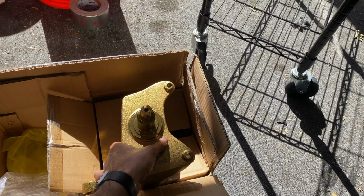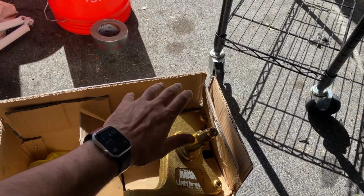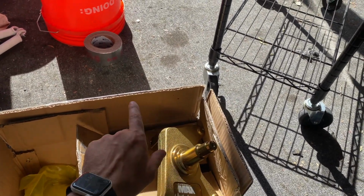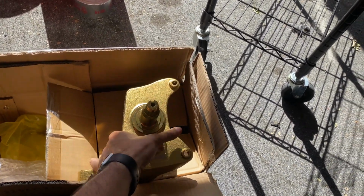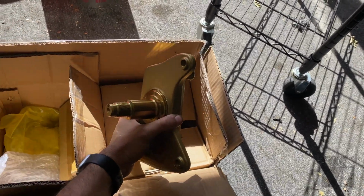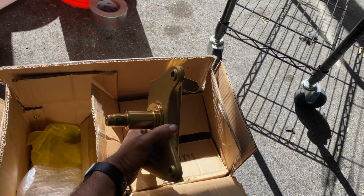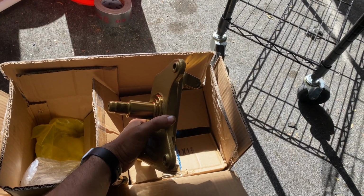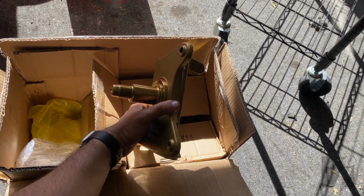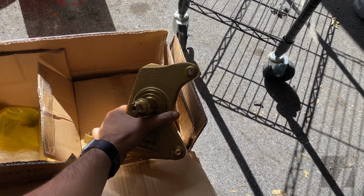When you don't compress the suspension, also, again, the upper control arm stays away from hitting that coilover, so we'll be safe. This is just kind of like an added insurance in addition to the camber plates, and we should be able to get a lot of angle out of the car and also run it safely. So this is going to be a project in itself.